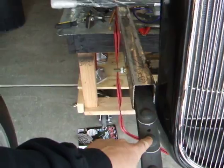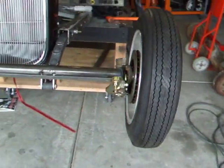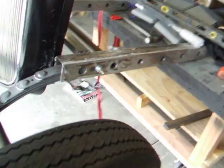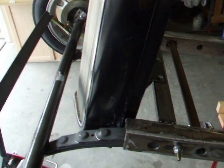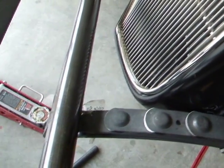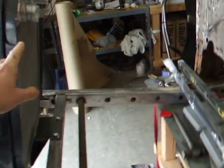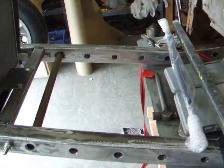These springs are inch and three quarters wide, so it's a nice way to go. But you've got to remember that any time you do this, you're kind of limited. With the radiator core support and the axle and everything, you get about 2 inches when you rotate your axle straight up and down. I kept 31 inches from the firewall to the core support so I can squeeze a big block Chevy in there.